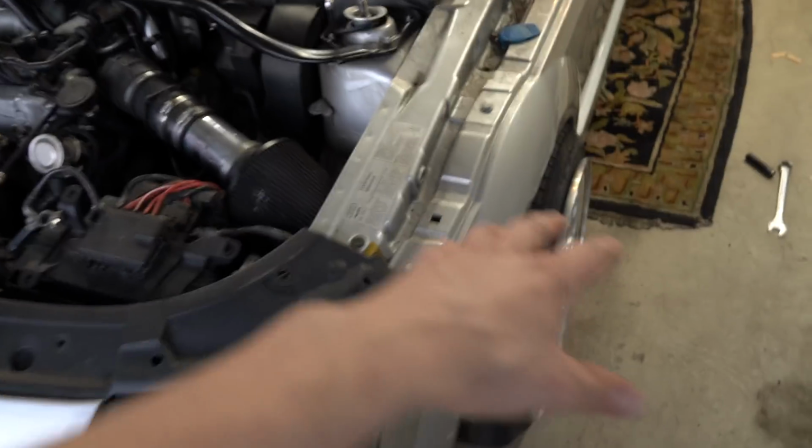So I'm really liking the -7 degrees of camber in the back. And I feel like that allows me to have a decent amount of traction. And you guys saw me make those arms. Those arms came out absolutely amazing. And we're gonna relocate the top hats where everything mounts up on this car. We're gonna have some camber on this car.